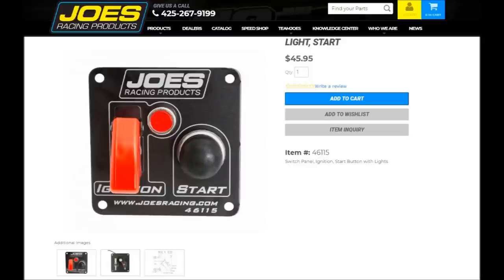Your ignition switch is really made for a car — or at least an older engine, older car, tractor, or even an inboard boat. You basically send power to the coil and that keeps the engine running. You remove power from the coil and the engine dies. This switch would work perfectly fine in that application. My neighbor at the shop has a tractor whose switches are all broken, so we start it via a jump wire and a screwdriver. This would work perfectly in a tractor. For your outboard, not so much.